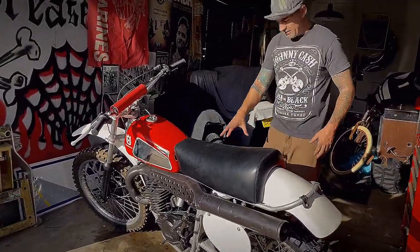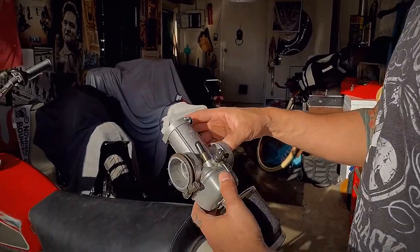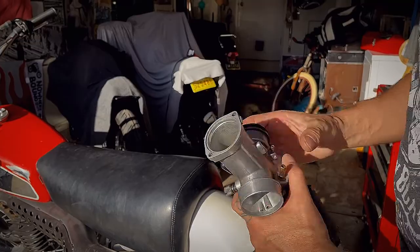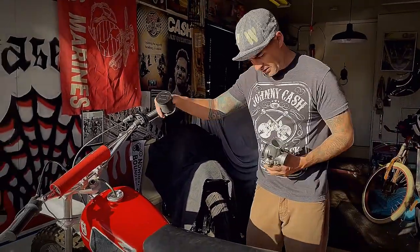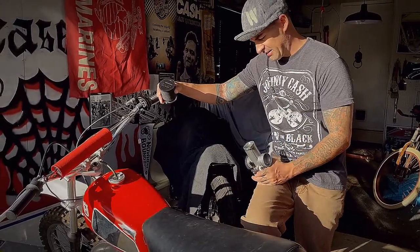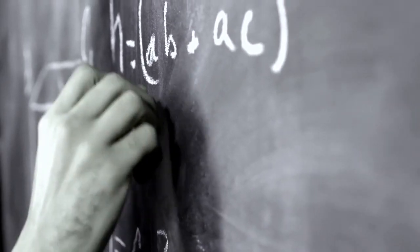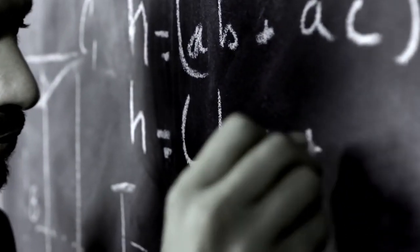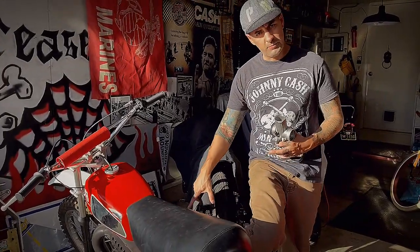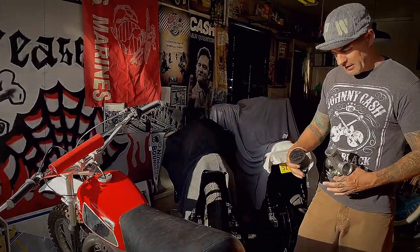The next thing I've been working on is the carb setup. This is the original Bing carb — pretty simple, just a pump and an idle adjustment, basically air intake adjustment. Once I started rebuilding this thing a couple of times, I noticed the spark was good from the plug, but it's not shooting gas into the head at the rate it needs to. I tried rebuilding it and reworking the float levels, but I think I'm going to spend more time on this carb than if I just got a new one. I'm thinking about going with a Mikuni and rebuilding the manifold to run it with a Uni air pod. I didn't want to go with the original airbox — it was big, bulky, and hard to find parts for.